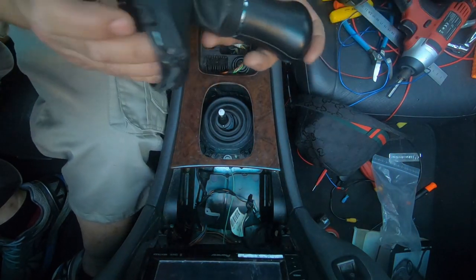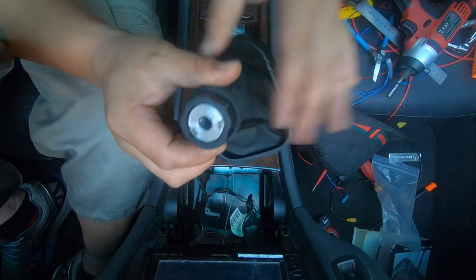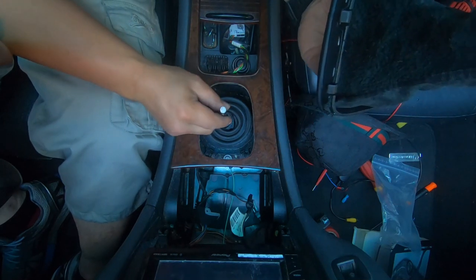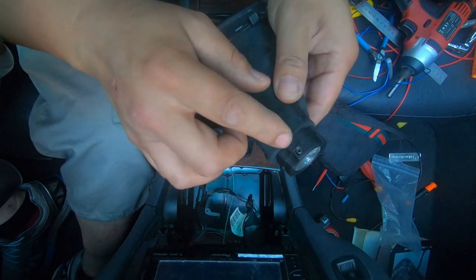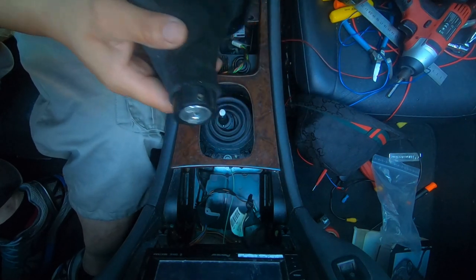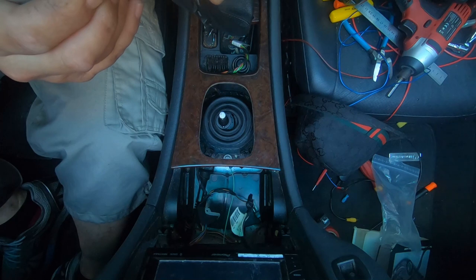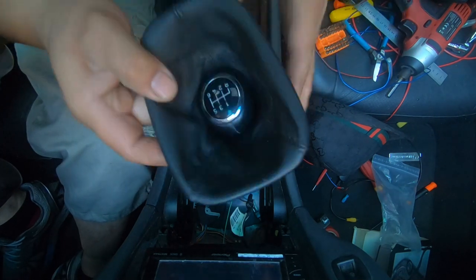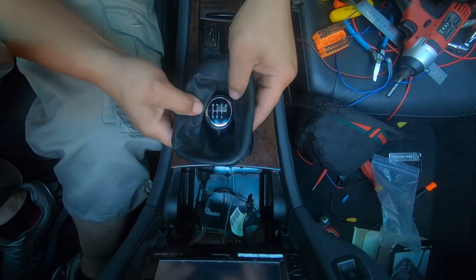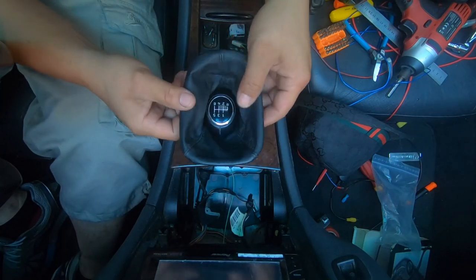To install your new one — and this is also really simple, there really is nothing to it. This is basically your old-fashioned gear knob style gear stick that simply screws into your gear stick. All you have to do is push this straight on and then you have three Allen grub screws — they are a 2.5mm grub screw. Lift up your boot so you can see what's going on down here, and line up your gear knob straight. You need to line it up straight so that when you screw it down, it will sit straight.